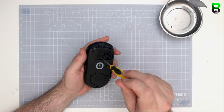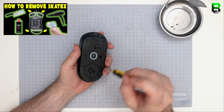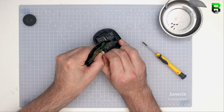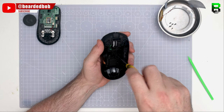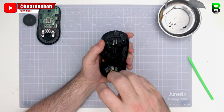Now I'm going to be using a lighter fluid technique with a sponge here to remove these skates. I've done a video on how to remove skates and other methods as well if you don't have this, to make sure you don't damage them. These Logitech skates don't come apart too easily, so you might damage them. I'd recommend replacing them, and if you need to, I've got a website that sells replacement skates for it, as well as many videos on my channel comparing which skates are best for which mice. So worth checking those out as well.